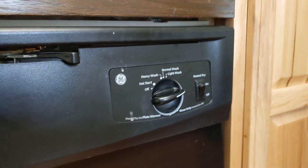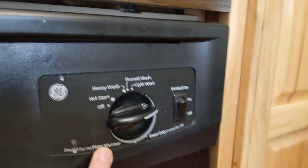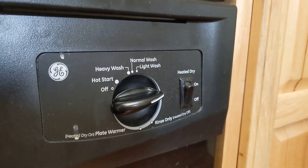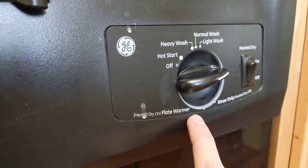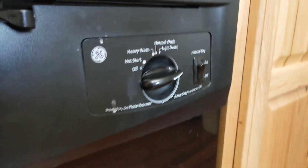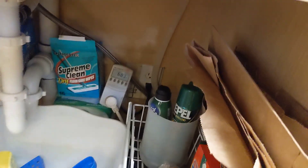Now this is obviously a very basic dishwasher, which is the reason I bought it — there's very little to break here. You've got a mechanical timer with contacts that powers the whole machine and energizes the various components as needed. I don't use the heated dry feature, but if you turn that on, when it gets down to that point it energizes the heater again in just air with no water circulating, to help evaporate moisture off of the dishes. But clearly it does in fact heat the water with the heating element.